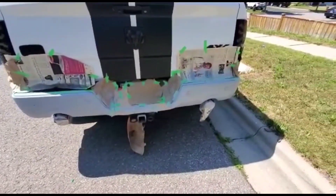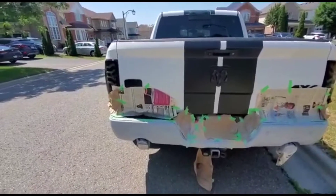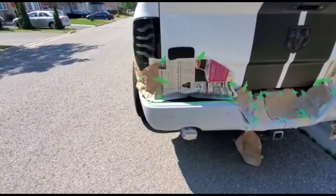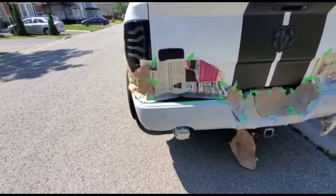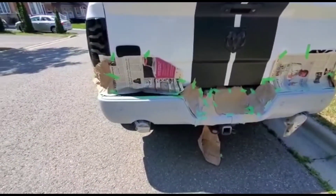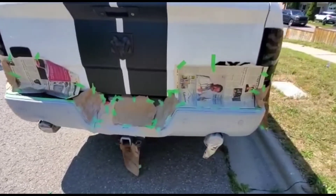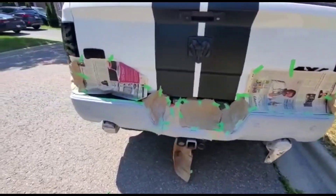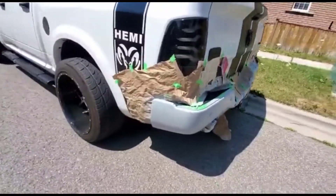The bumper was chrome and I wanted to get it white because I want to maintain a black and white theme. First, what I did was scrub the bumper with fine sandpaper, because paint doesn't stick well with chrome — especially metal chrome. Plastic chrome sticks better, but metal doesn't stick perfectly. So I scuffed it up a little with fine sandpaper, then made sure to tape the areas properly. That gray you're seeing is the primer I added after scuffing and taping.